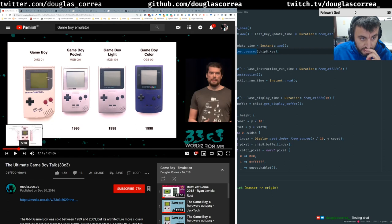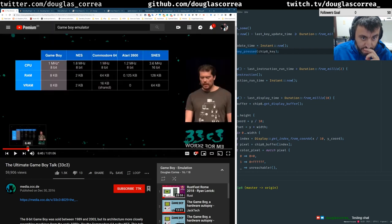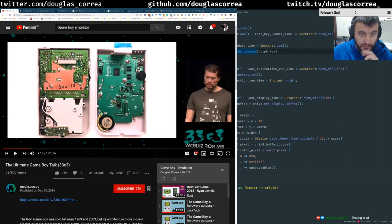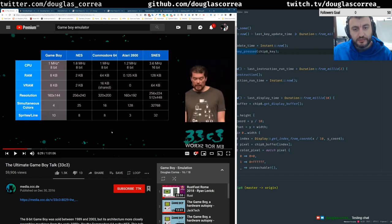So this video is very nice. There's a lot of stuff here, like discussing the CPU and the clock. The clock is 1 MHz, but the guy explained that actually the CPU is 4 MHz, while the memory is only 1 MHz, and every CPU function is tied to the RAM. It uses 4 clocks of RAM for 1 clock of the CPU. So it's all based on 1 clock, 1 MHz.